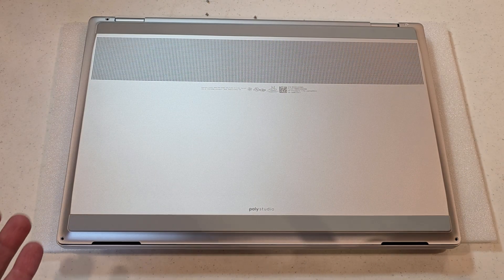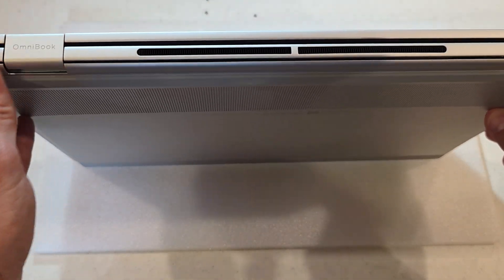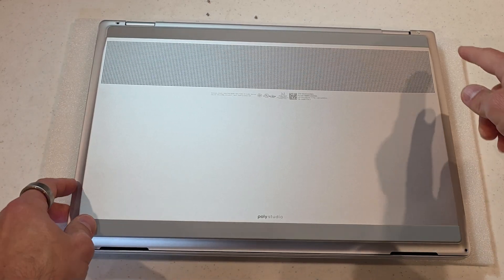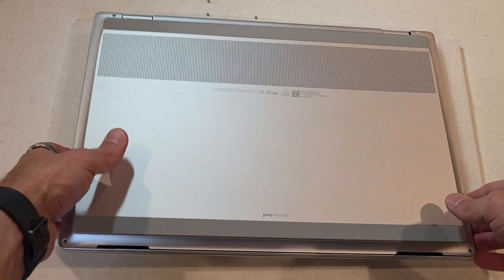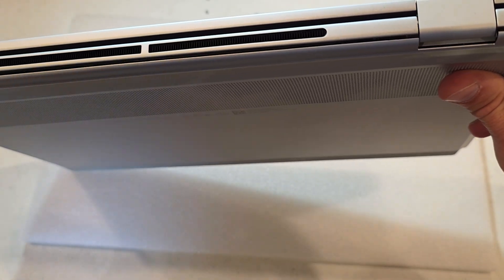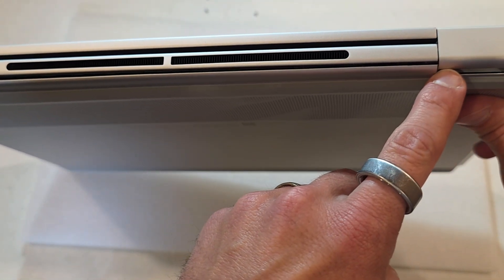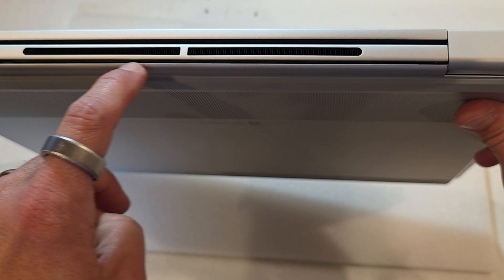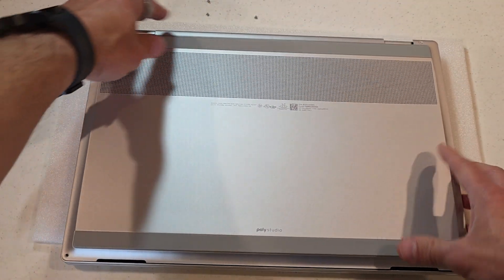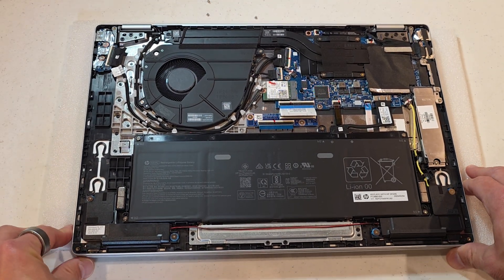Next up, we've got a brief look at maintenance. Those of you who appreciate being able to get inside your machine will like the fact that there are only four screws — they are Torx screws securing the rear cover. This one up here is captive and does not come out; the other three do. However, it's kind of difficult to get this cover off, so don't be fooled. It's definitely not like business grade sensibilities here in this respect — you have to kind of pry. By my estimation, the best place to start is near the captive screw, which kind of pops this loose, then work your way around it.